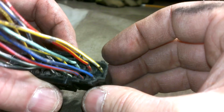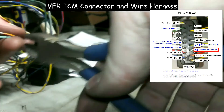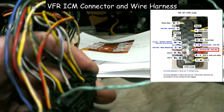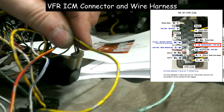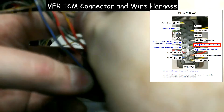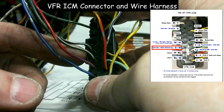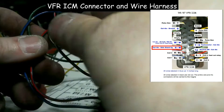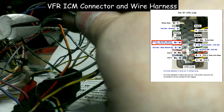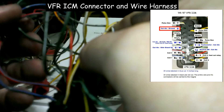Clipping the light green wire — the neutral switch — leaving about four or five inches. That one goes on the Magna. Next, the tachometer wire: yellow with a green trace. Then I need to cut the green-white, which is the sidestand wire. Also the black-white. And the last one is this green, which will be tied to black on the Magna harness.